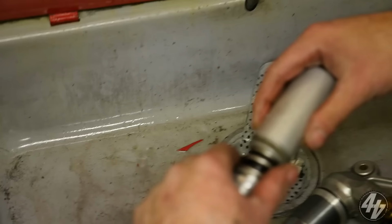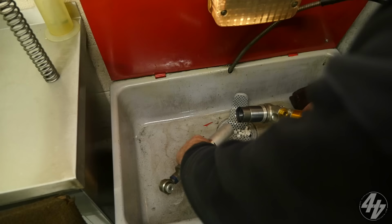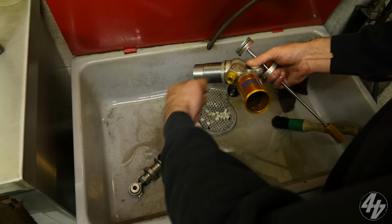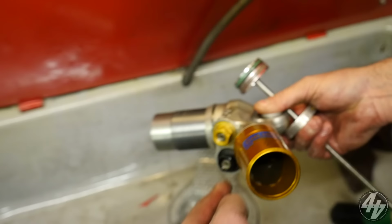All right. That's a little piston ring. One tube sort of inside another tube makes it twin tube. And the oil is between them. So this is your piston, your floating piston, your free piston. Can you see the oil sat behind it? That would be full up with oil in that gallery in the twin tube, controlled by both your compression and rebound valves.